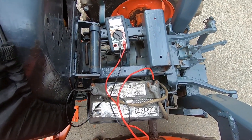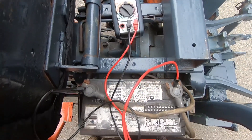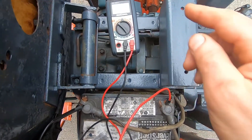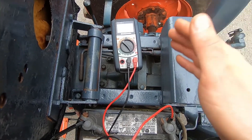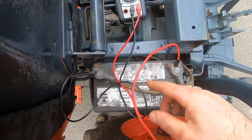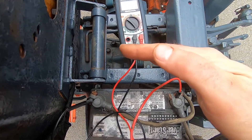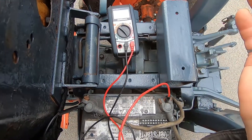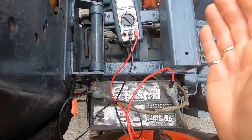Right now it's running at about 2000 RPM. You can see it's charging at about 13 volts — 13.2, it bounced around a little bit. I just started it. The battery voltage was 12 before I started, which is normal — a little low maybe. Anywhere from 12.5 to 14.5 volts when you're running is considered normal. This battery voltage will climb as the battery charges — it was discharged a little bit. What'll happen is it'll charge up from 13.1, 2, 3, up to about 14 volts, and then it doesn't rise any higher regardless of RPM or what electrical loads are on it. That proves it's adjusted properly.